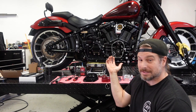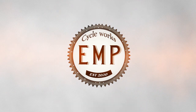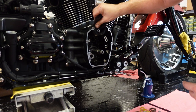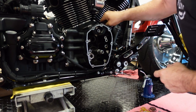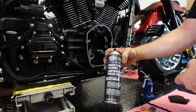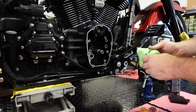It's already torn apart. Let's get it back together. First step is to clean the gasket surface using maroon Scotch-Brite, and then we're going to hit it with Advanced Auto Parts brake cleaner on a microfiber rag to clean up any oil or residual Scotch-Brite that may be there.